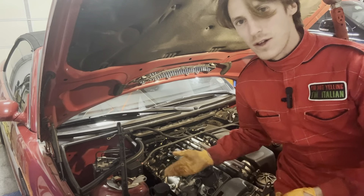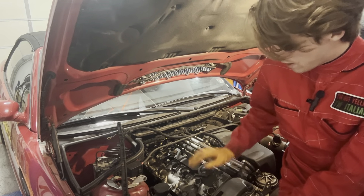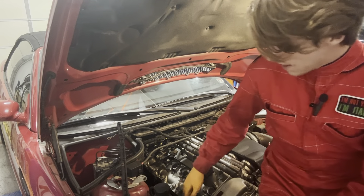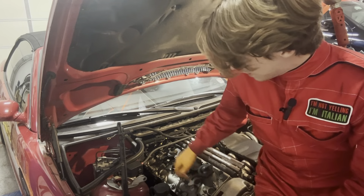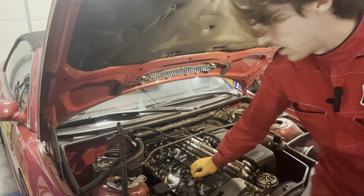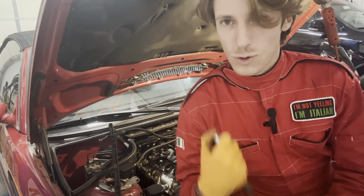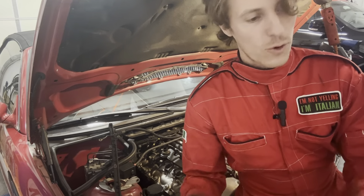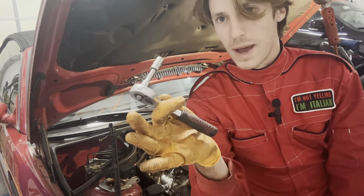Now it's time to take off the main screws holding the valve cover. The only two screws that are slightly different also have two different gaskets. Your kit should come with the main valve cover gasket, gaskets for all the screws, and gaskets for the six coil holes — that's what you want to buy to replace everything. According to mechanics, you can use a power tool to unscrew things, but not to re-screw them — you want to torque them correctly when putting them back.